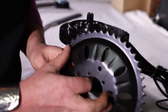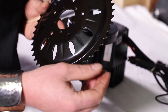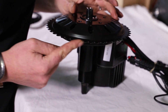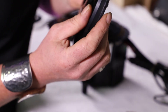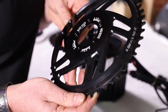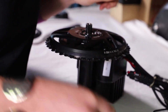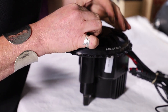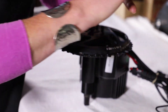Fitting the chainring onto the motor: the motor comes with a standard 46-tooth chainring. It's designed to give you the optimal sort of range from torque to speed, and it's designed to pop straight onto the side of the motor here. You can see that it dishes inwards a little bit. The other option is to go for a lecky bling ring — this is an upgrade which helps you differentiate between a wide and narrow tooth pattern. These are actually designed to hold the chain better and they've got a bit more of a dish to them. It's important to get the right chainring on before we fit the motor, because we need to make sure that the ring is clearing the chain stay — we don't want the chainring grinding away on the chain stay.